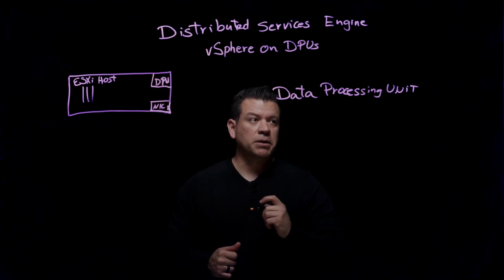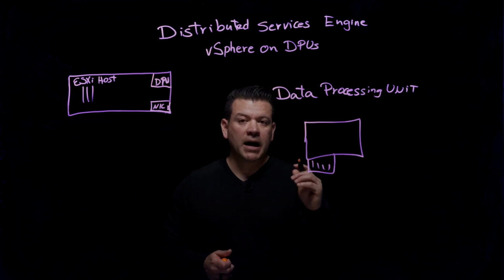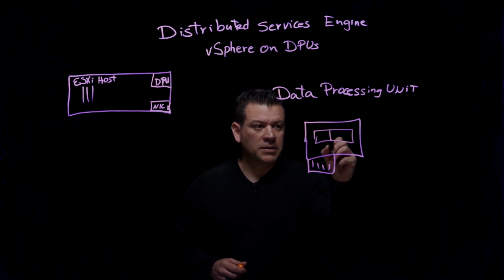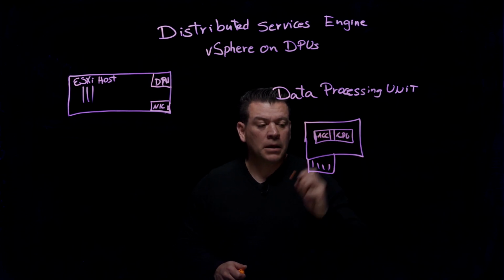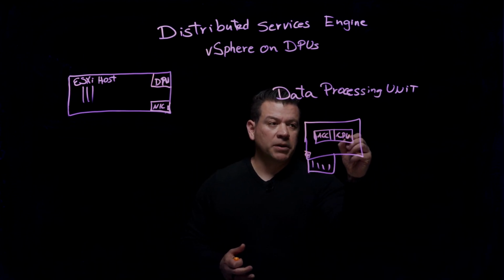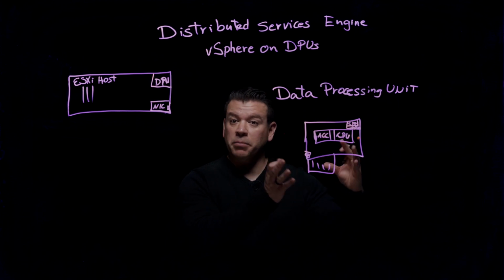First, let's talk about the DPUs. So the DPUs look like a NIC. So these are connectors. And the difference here is that we have ARM processors. So here, I'm going to draw this. There is an interconnect between a CPU here and a programmable accelerator. So this is the port for the NIC. Right, the difference here is that we have that CPU, we have some storage, we have memory. Right, so now it looks like a mini tiny computer.